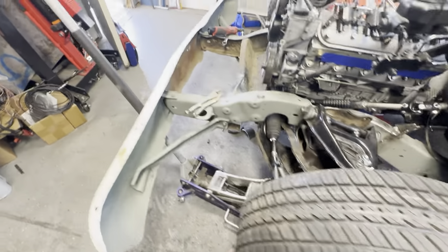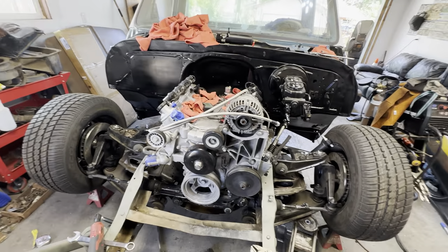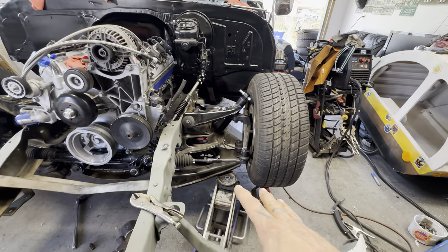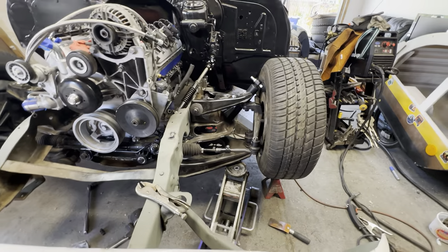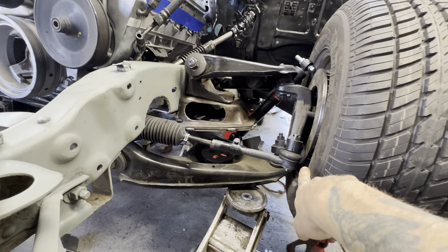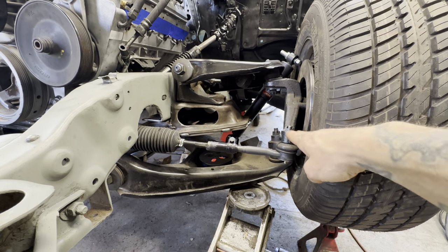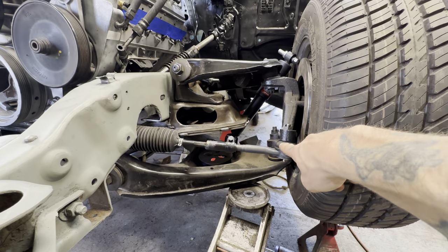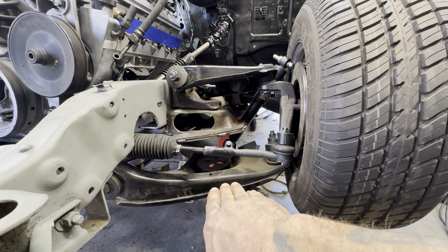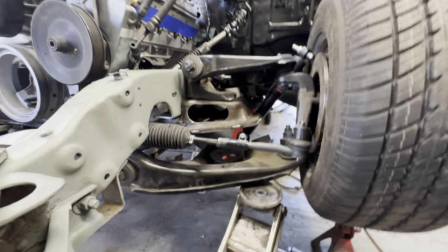Getting tight in here — I'm so ready for all of this to be out of here. Tight spaces, I don't like it. This is all in. I want to say that's like normal ride height — low-right height, yeah, that's low. Got all this buttoned up, these are temporary. I'm probably going to go with a heim joint and something else, haven't decided yet. I had to flip it because these are three-inch drop spindles, and with the ride height already so low and where I ended up putting this, it was better to flip it.